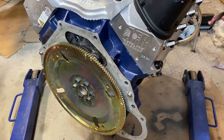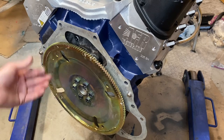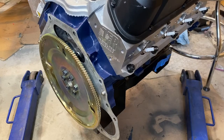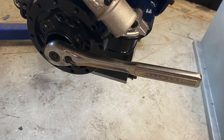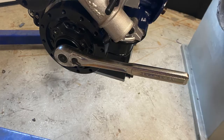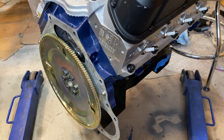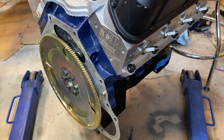The torque spec for these bolts is 75 to 85 foot-pounds, so we'll target about 80 foot-pounds. I'll position the torque converter with the drain bolt at the bottom as a reference point. I'm going to torque these to about 80 foot-pounds off-camera. Pretty easy job overall — hope this helped, thanks for watching, and I'll catch you on the next one.